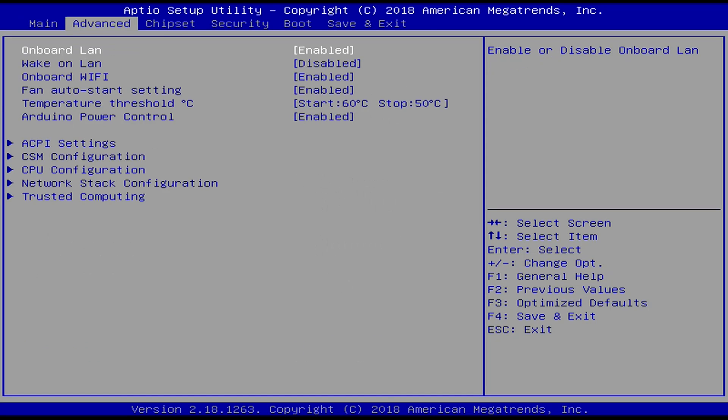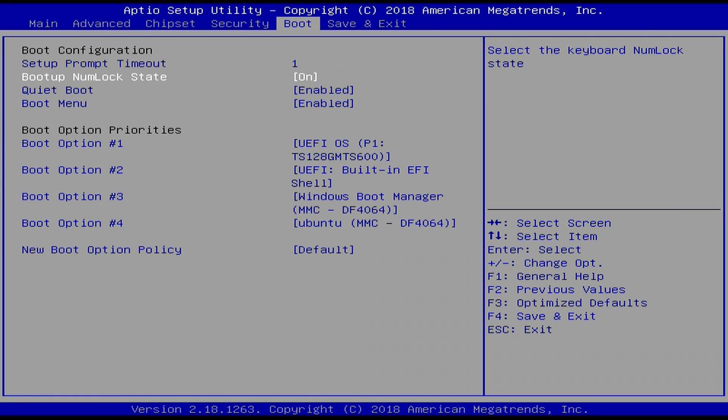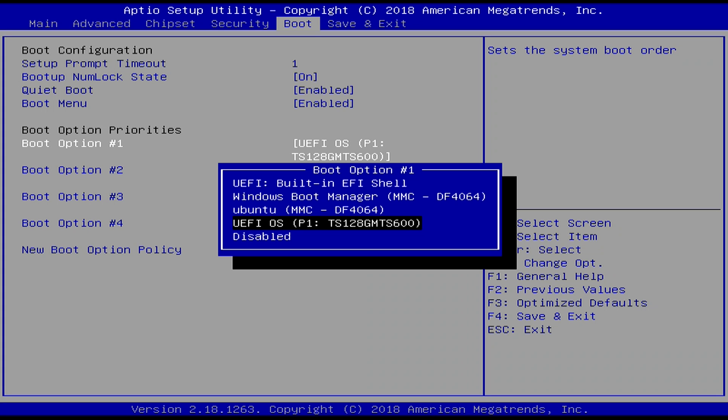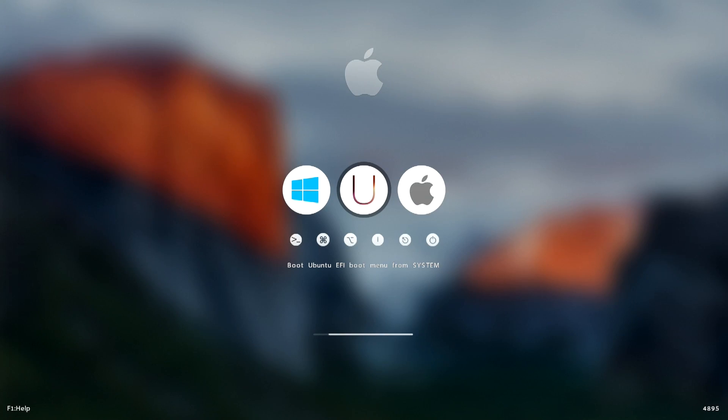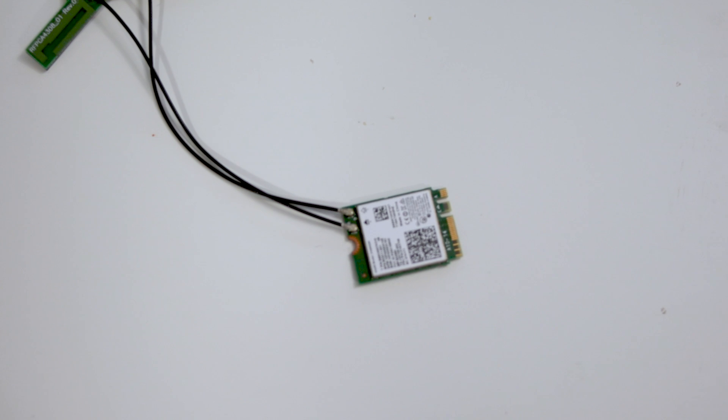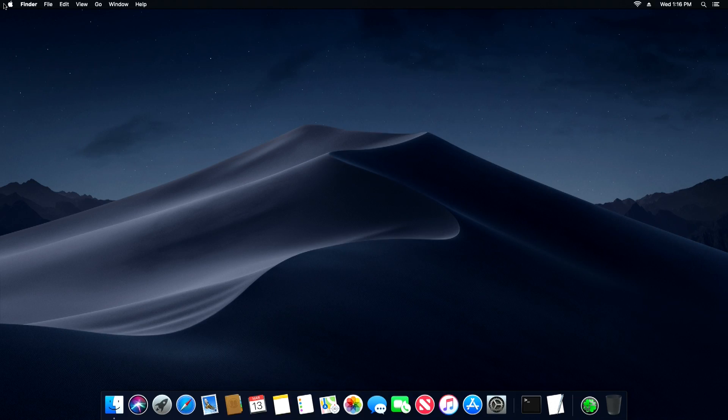You can remove the USBs and reboot the system. You might have to go into BIOS and change the setting for which one boots first - you want the UEFI one, which will say 'UEFI OS.' Once that's done it will go right into your boot manager. Now that everything booted as it should, I'm going to go into my macOS bootloader. Since I am using the Broadcom Wi-Fi - I'll leave a link in the description below on where you can get that - it is native to Mac so it will just boot up with Wi-Fi and work. But you're going to have a little difficulty with Windows and Linux, and I'll show you in a second what I did.